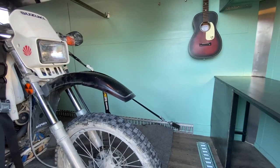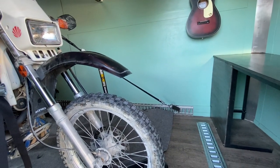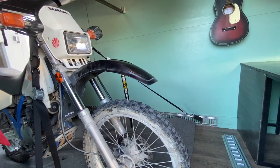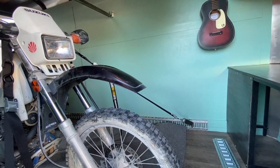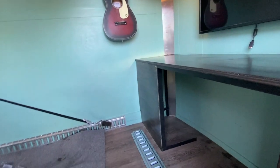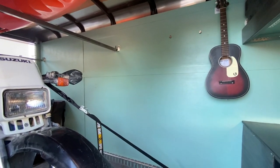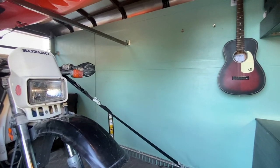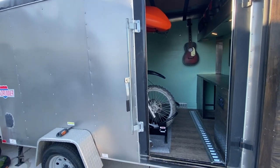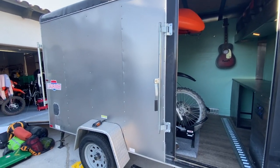For anyone thinking about doing this with a cargo trailer, think hard about how much stuff you're going to load up and what that weight looks like, especially with fixtures. We don't haul any plumbing — I usually camp where there's a pit toilet or showers nearby — outside of maybe a couple gallons of water and a Yeti cooler. If you add fresh water plus gray or black water it starts adding weight quickly. If I were to do this project over, I'd probably jump straight to a trailer with two axles and electronic brakes, which gives a lot more headroom for weight.